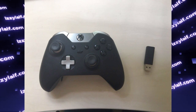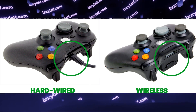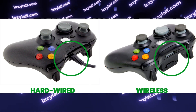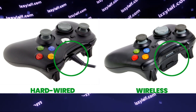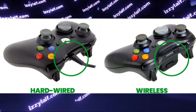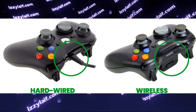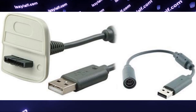If we go back to the days of the first next-gen consoles, which was Xbox 360 — about 20 years ago — Xbox 360 controllers came in two flavors. The first was a wired USB controller with a non-detachable wire soldered directly into the controller. That wired one was a normal USB device; plug it into your computer and you can use it right away. However, the wireless controller, even though it had an adapter with a wire, was always working in wireless mode — it only used USB for power or charging a battery pack, while the connection itself remained wireless.